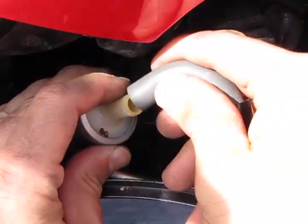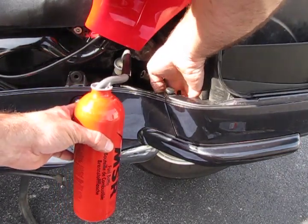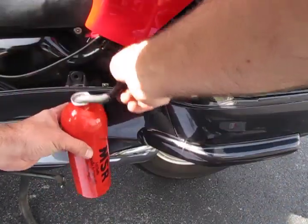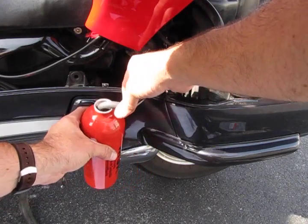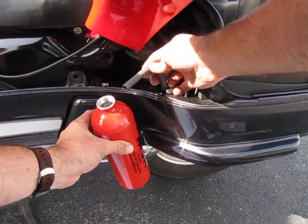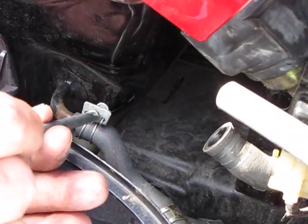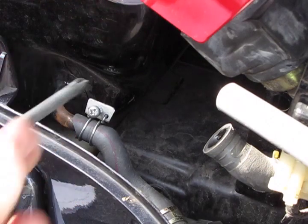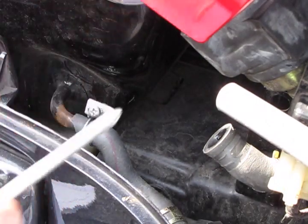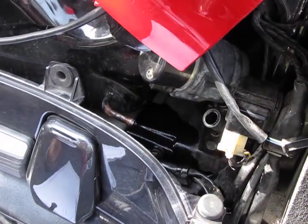Make sure you have rags underneath to catch that — I didn't. Next, connect a rubber hose onto the fuel filter that will allow you to drain any remaining fuel from your tank. Unclamp the hose. Before doing this fix, I ran my tank down to almost empty so that not much fuel comes out into the bottle — just a tablespoon or two. A single hose clamp with a Phillips head screw is the only thing holding the hose and fuel filter in place at this point. Loosen the Phillips head screw — don't remove it or the whole contraption falls apart. I'm going to be replacing this hose so I'm not real gentle with it. It should just pop right off.